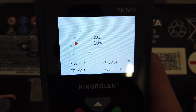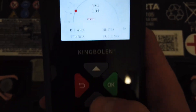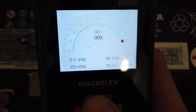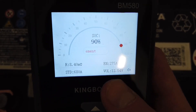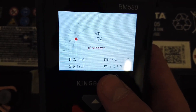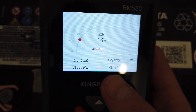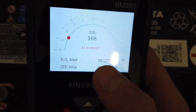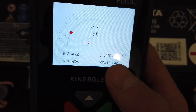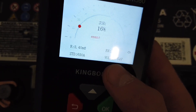State of health is 16%, which is not good. If I scroll, we can see state of charge is 90%, so it's charged and the voltage is correct — we have 12 and a half volts — but the state of health is very low. It should give 680 amps of starting current but it gives only 275 amps, so this is why this battery had to be replaced.